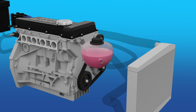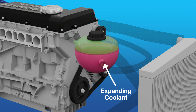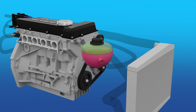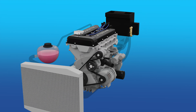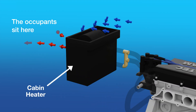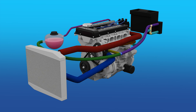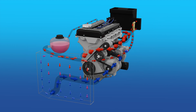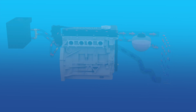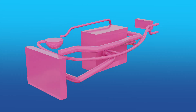A critical component in the cooling system is the expansion tank which has three broad uses: trapping any gases that build up in the coolant, allowing space for coolant to expand into as it heats up, and providing a pressure release valve in its cap. The optional fit cabin heater takes heat out of the coolant and dumps it into the cabin using a small radiator and fan — not all Caterhams have a cabin heater fitted. There are all sorts of upgrades you can do to the coolant system pipework, but each pipe presents a sort of resistance to flow, so the diameter and length of the pipes are important to get the correct flow and cooling effect in each loop. The coolant in a modern car is a mixture of deionized water and glycol, altogether often just called antifreeze.